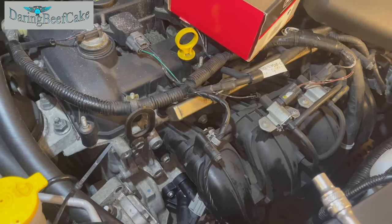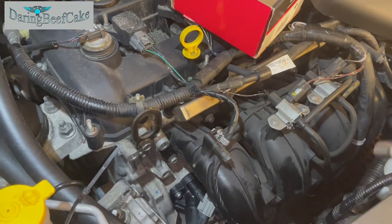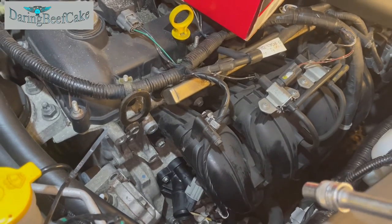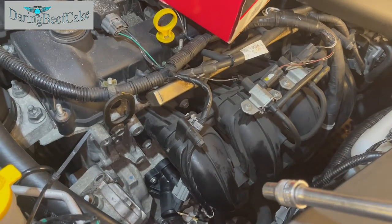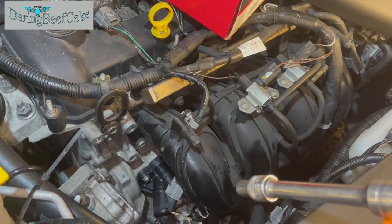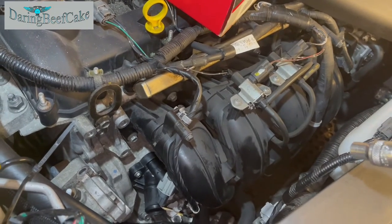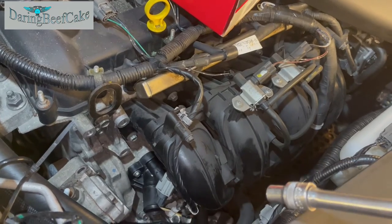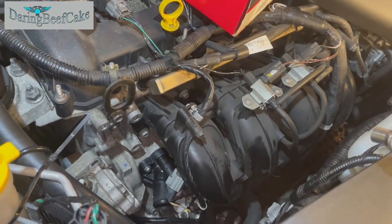So let's avoid any problems. After all, if you do have a small leak from there or anything because you didn't tighten them enough, then you could always remove your pump again and tighten them a little bit. It's safer to do that, even though it looks like a long way round, but it's safer not to break the bolts.